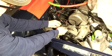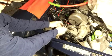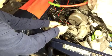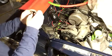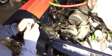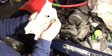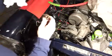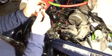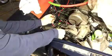First we've got to get this in place. Make sure we got it right. Oops. Wait a minute. I'm putting this in wrong. It's got to go up like this. So I got to remove this piece and put it in correctly. There we go. I need to turn it around like such. Put it back in place. There we go. Reason is the bolt's got to go through and go to the threads on that end. Bolt goes through, but it's got to go through the alternator.